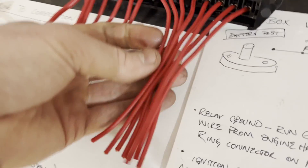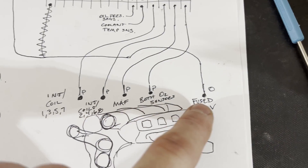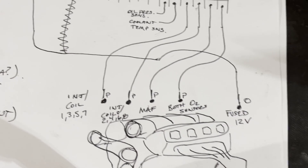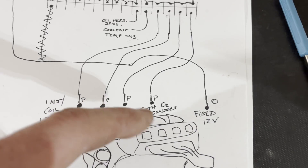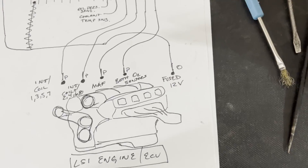From there I'll have wires coming out with different size fuses — whatever I need — running to my O2 sensors, MAF, injectors, coils, and the ignition source on the ECU. I'll also have a Y off the constant 12 volt to supply constant 12 volts to the engine ECU. Doing this keeps the LS engine completely separate on its own fuses from the Mazda. I will be tapping the ignition 12 volt from the Mazda harness, but it's just one wire — so overall I'd consider it a standalone harness, just getting an ignition source from the chassis.